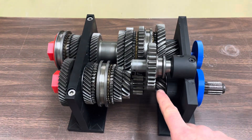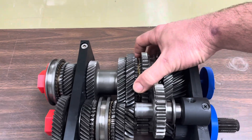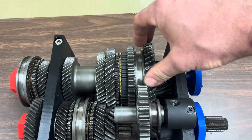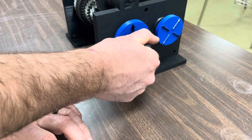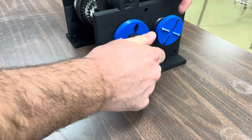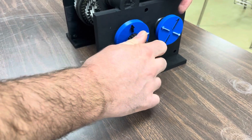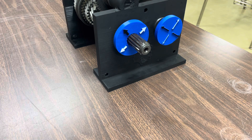First gear is the relationship between the smallest gear on the input shaft and the largest gear here on the output shaft. When the shift collar is shifted into place — like it is right there, you can see it's not in the middle anymore — it has locked this first gear to the output shaft. That will be first gear. So I'm going to turn it around until this white arrow makes it back to that location. The black arrow has been around once, twice, three times, and almost four times. So that gives you an idea of what the gear ratio is for first gear — it's almost four to one, three point something.